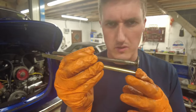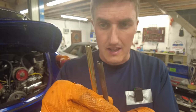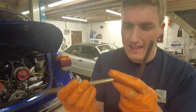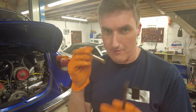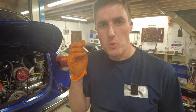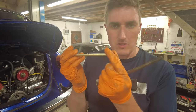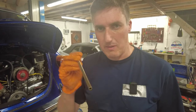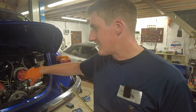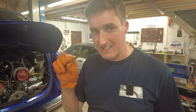It was small money but definitely going to make a big difference to how things behave on the accelerator cable front. So let's cast that one aside and get a new one, get a new guide tube in, and put a new cable in. You can see here the difference between the old tube and the new one — there's about an inch of a difference, and an inch makes all the difference. We're going to feed this in first, and the reason we're feeding this in first is because the new cable outer that goes over the driveshaft also goes onto the end of this and will keep it in place. This is supposed to be free-floating — it's supposed to stay in the fan shroud but not actually fall out, and it's supposed to seat itself in.